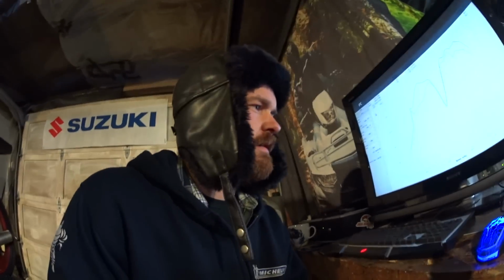Since the ignition point is moving relative to the points I've set, it seems, I'm not sure if that's what's happening yet, there could be something else going on, but the ignition light shows that, and I'm getting good results by advancing the timing more than it should be,